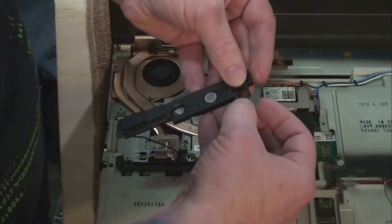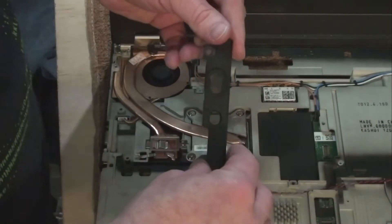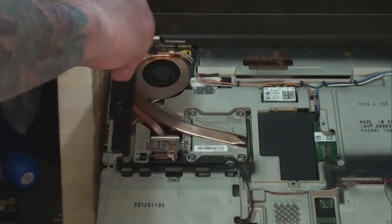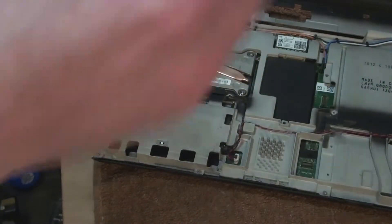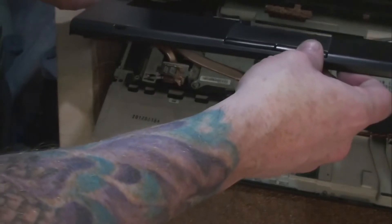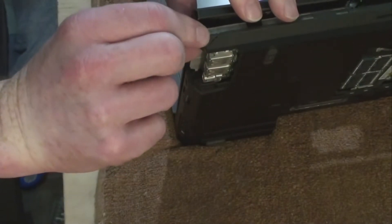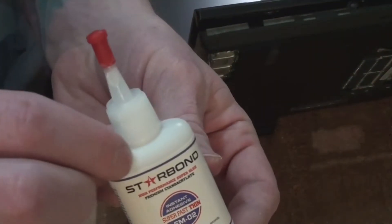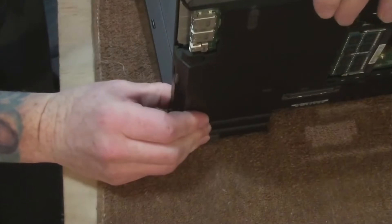At this point, I realized my mistake with the grommet and had to fiddle around with reinserting it into the speaker mount. Once done, just slide the speaker into its recess, slide the grommet over its mate, screw it down, and make sure to tuck the wire at the bottom back into its little recess. Putting the top cover back on is a matter of sliding it back into place, reconnecting the touchpad connector, and snapping the edges down. Check your lid release mechanism before doing this — I had managed to slightly get this out of whack and had to make minor adjustments. Since I had the problem with the broken corner, I fixed it with some cyanoacrylate — a few dabs and a bit of drying time later, the corner was reattached.